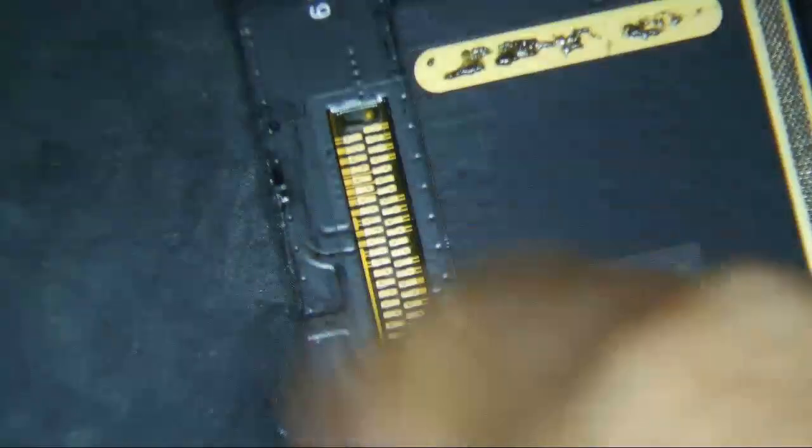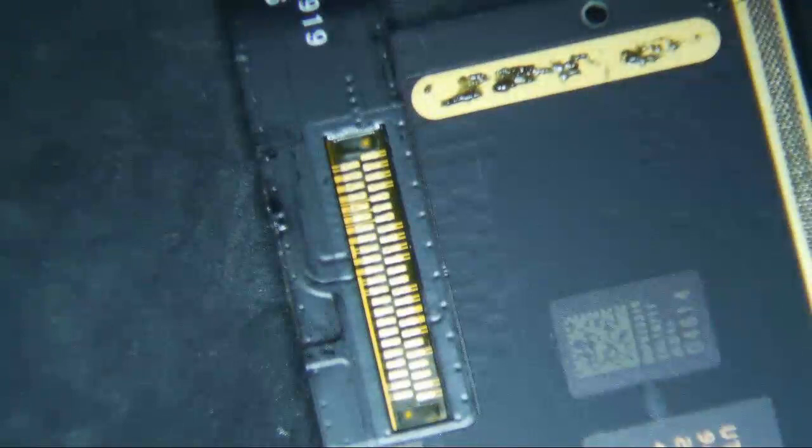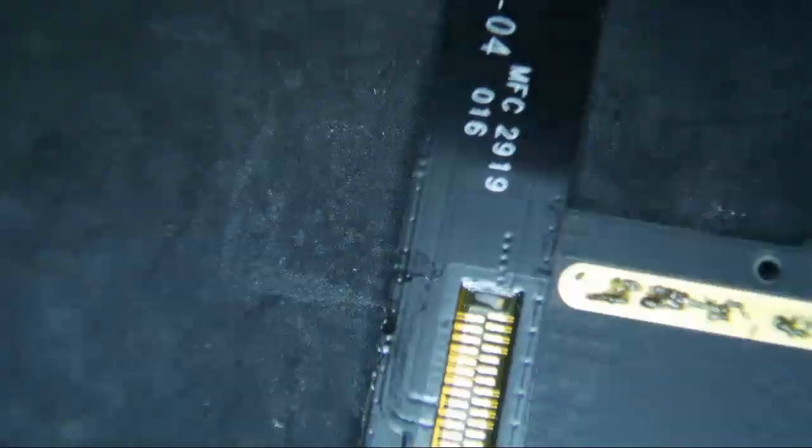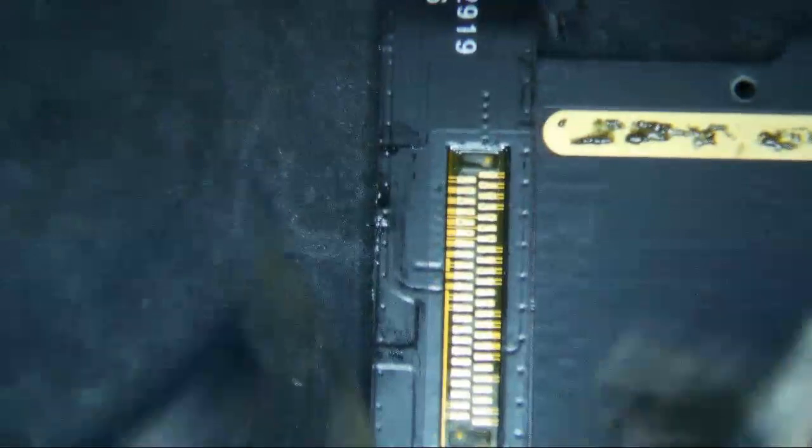In terms of removing this charge port, I just use heat and blast it. I put a glove on because the tweezers get pretty hot. I normally go with pretty high heat — I'm at 450 degrees Celsius with airflow at 40. I get pretty close to it. If there's a little plastic bracket on the other side, you definitely want to remove that first, otherwise it just gets burnt to a crisp.